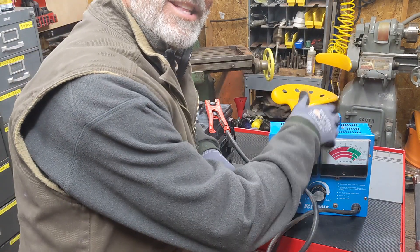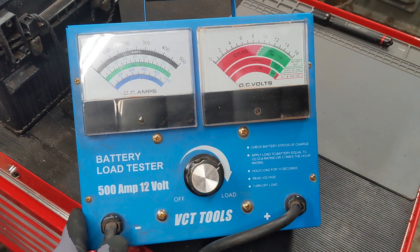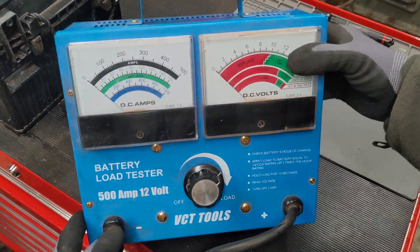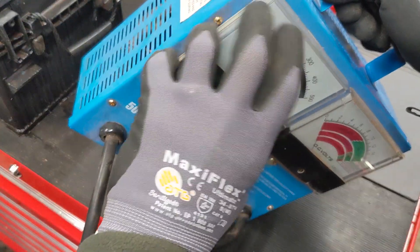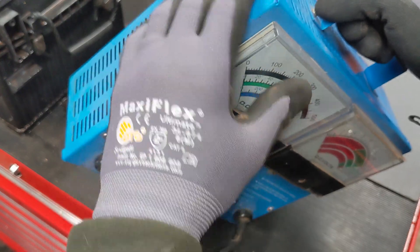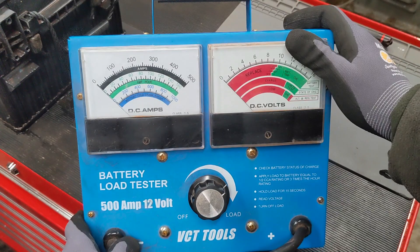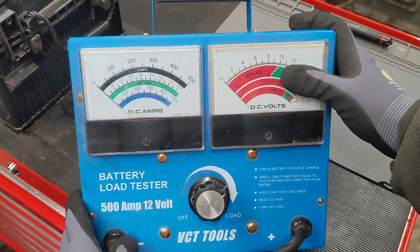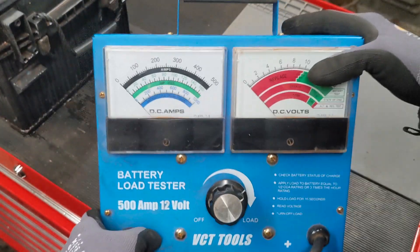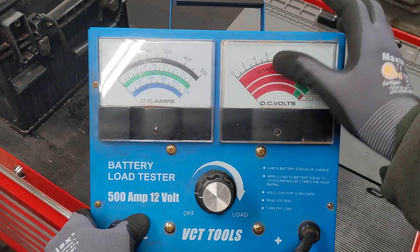I love the smell of the dust that burns off when it's under load. Let me interrupt the demonstration just to show you how this works. This is a carbon-pile load tester. There are other load testers that are much smaller that apply a kind of micro load, and then based on that micro load and some electronics inside the box, they can estimate the current output capacity of your battery. I kind of like the old-school one - it's got a big coil in there and a variable resistor, that's really what this is.